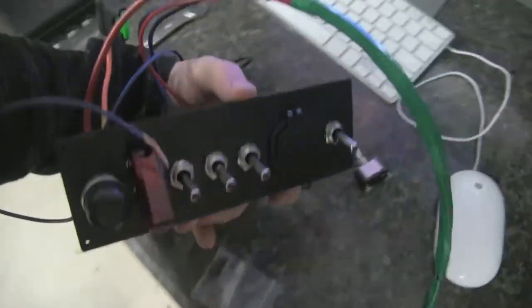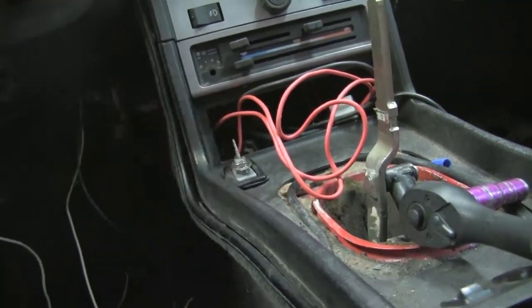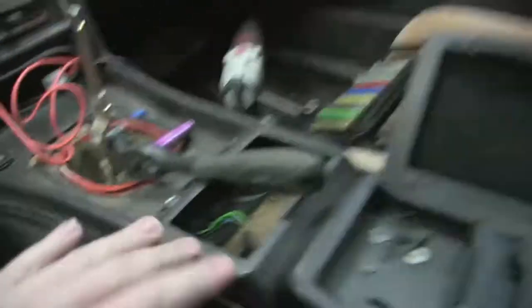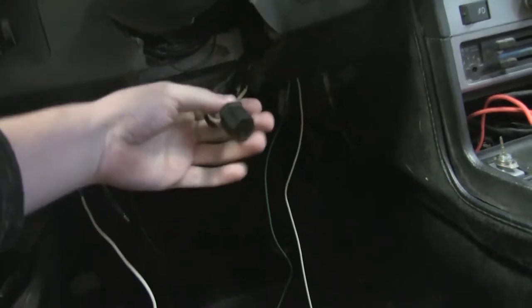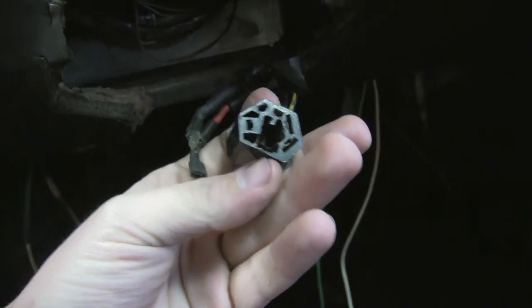First I got to remove all these wires that are in there. Big thing in this car is there's a bunch of random wires to different things. They have this cut off here which I'm not really sure exactly how they wired it up, but I don't really need this switch — I'm going to have a main power cut off already inside, plus a power cut off on the outside too. So I'm going to remove all this stuff and figure out why those are wired there. It seems like someone pulled a bulb out the back — it could be like a check engine light. This is where I'm going to be wiring the main start panel in. It actually looks like it burnt at some point and melted in here, so this plug was bad anyways.